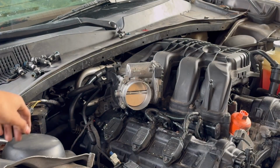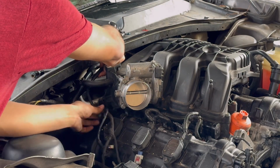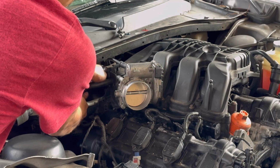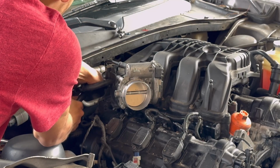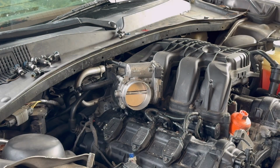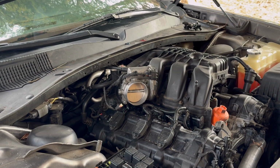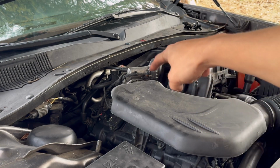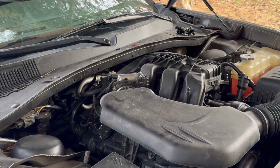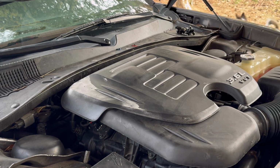Starting off with this one, then vacuum hose for the intake. And then this one. And then way back here. Just like that. Now the connectors. Okay, throttle body's connected, and all right, so everything on the intake is back installed. Now we just gotta get the hose back on. Hose is back in. There was just 2 hose clamps over there and right here. Just tighten those up, 8 millimeters. The last thing to do, reinstall the cover. Just like that. And we are done.